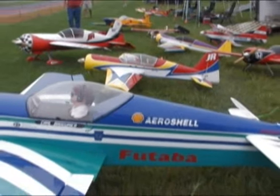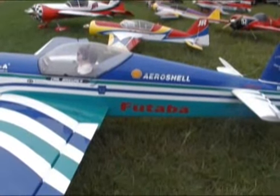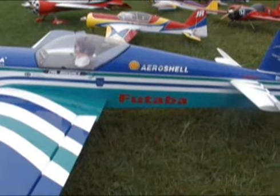Fly it in. We had fiberglass that split on the fuselage where we had to go in there and fix that, just from landing on rough runways, and outside of that, the plane weighs a lot. It's a 76-pound airframe, and it takes its beats and bangs when you're flying it by remote control, and you just have to keep up after it.